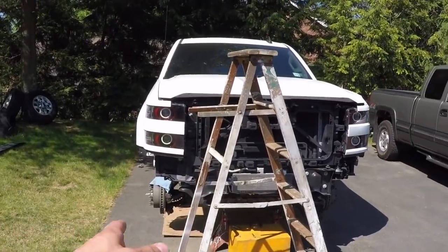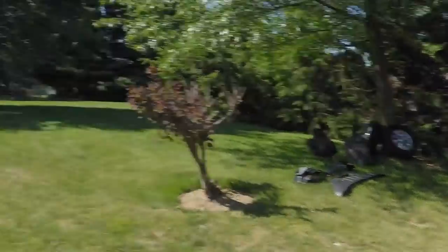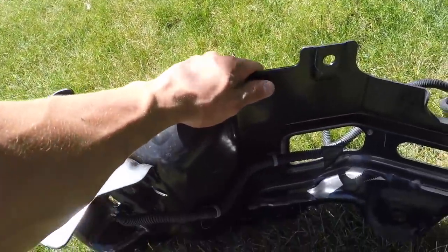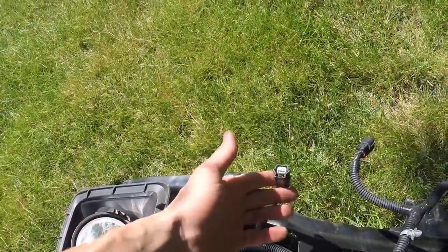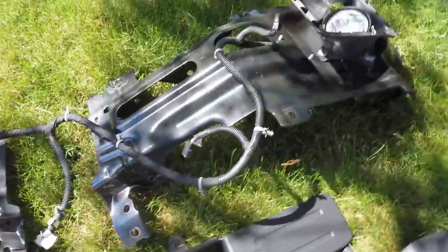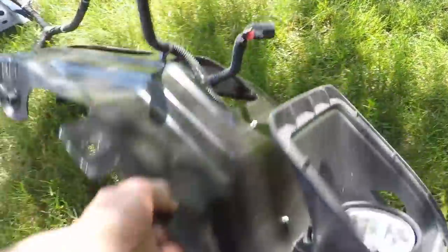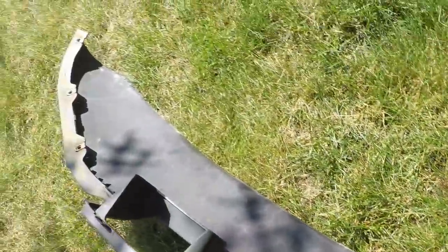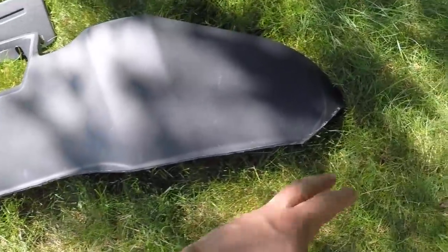Today is going to be wrapping the bumper. For those that have a Chevy with this kind of body style, I want to show you what pieces were in the bumper that I had to take out just to get to the actual bumper itself. Basically the structural integrity pieces, fog lights, parking sensor, two big wiring harnesses, the other half of the structural integrity, and down here the plastic valence that I've already trimmed.